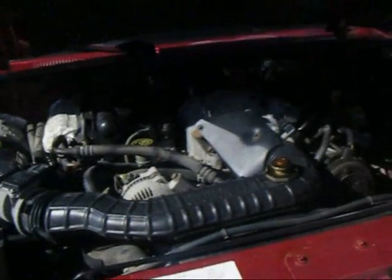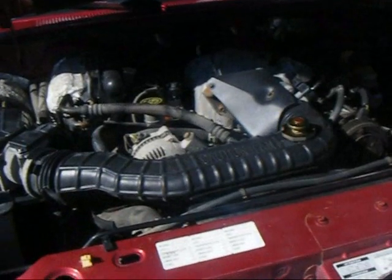Then you're going to need a hose to flush your system out. The next thing we do is go under the engine and pull the plug out to let all the coolant drain out. Now that we're under the engine, if you see that little plug right there — this plug right here — that is the plug for your radiator.